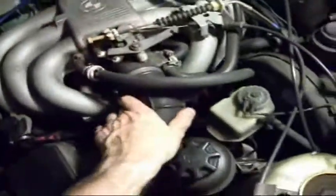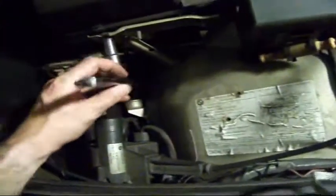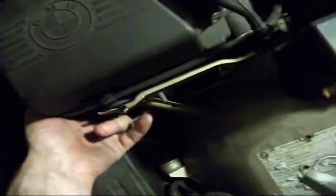Find your intake manifold, find the big breather hose, and that's going to lead to a box — inside that box is your air filter. Get your wrench and loosen the bolts on the air filter box. Typically you'll find some screws to loosen just a little bit, you don't want to take them all the way out. Down here you'll see a clasp. It's easier to not take the box out completely because there are other connections to undo — typically there are three or four hooks.